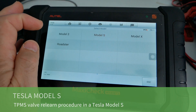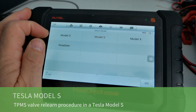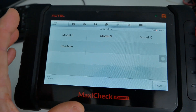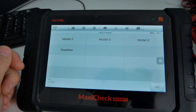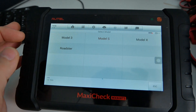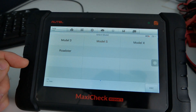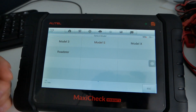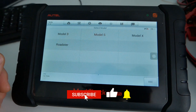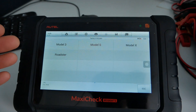On the question of whether you can fit sensors into your Tesla Model S without requiring Tesla to program them — a sensor in a wheel only has a frequency and a hexadecimal ID number. So as long as all the ID numbers are different, the ECU in the car will read those ID numbers and then read the temperature, pressure, and battery status. As long as you've given them different ID numbers, you can make the car learn what they are.